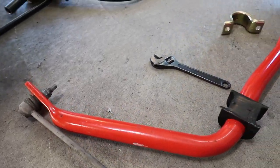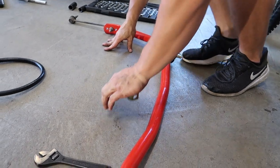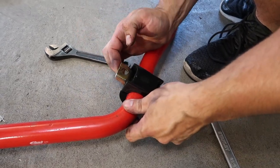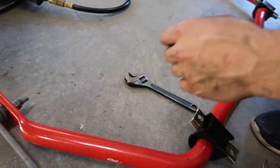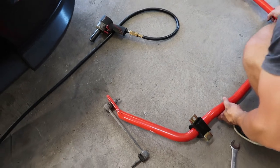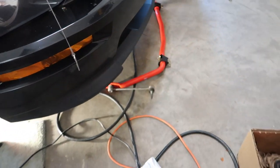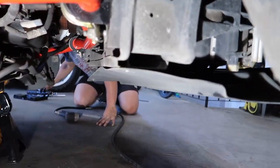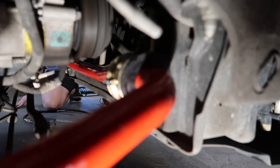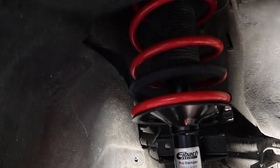We transferred the sway bar links. Matt's greasing up the fittings — making an absolute disaster of a mess. Might need to do some adjustment underneath the car. Time to throw it in. End links are on — nice and tight, hopefully they don't fly out. New sway bar's in. Just a matter of torquing it down now. There's no point putting a sticker on it since you can't see it anyway — it'll just look good at an oil change. But there's the suspension — looks pretty good.